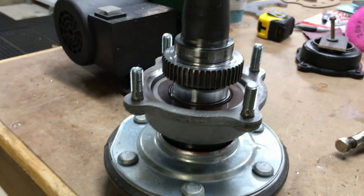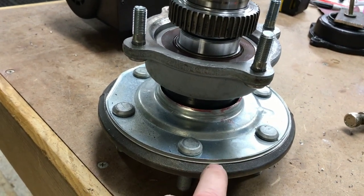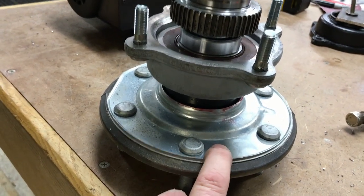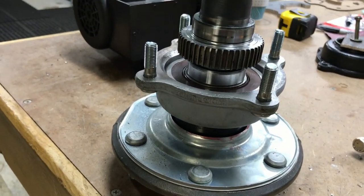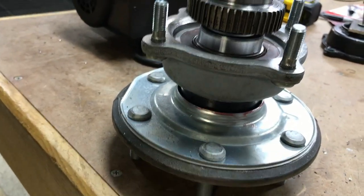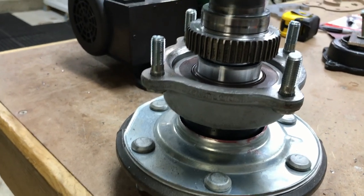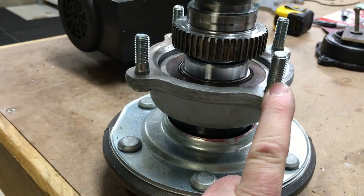I got some axles out of a 2001 — we just pulled them out from the junkyard. I cleaned up the axles, replaced the gasket, cleaned off the backing plate and the bearing cups, and put some cold galvanizing compound on it. I'm not really that happy with it — it's really soft and comes off real easy — but these things are always rusted so anything will help. I can maybe rattle can it if I want. I also replaced these four bolts.